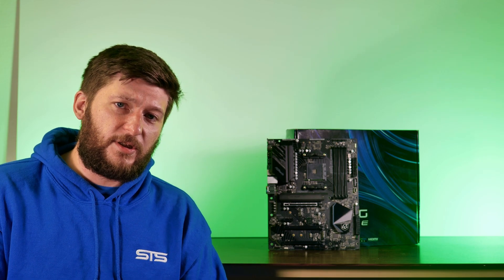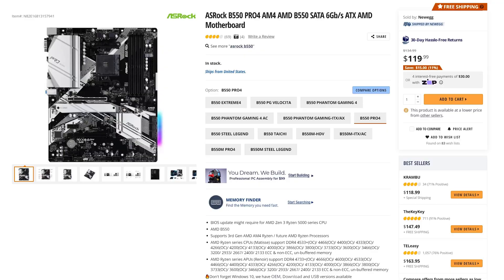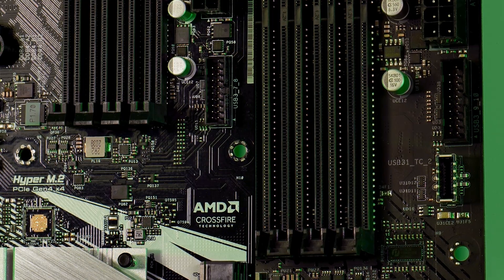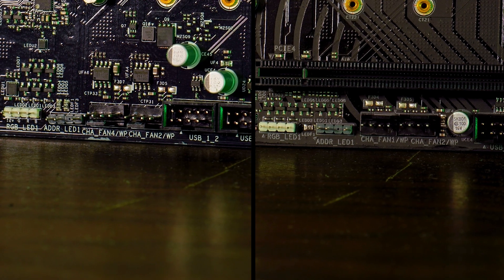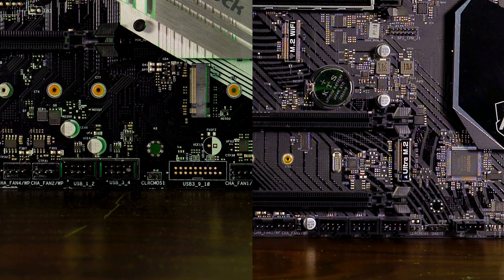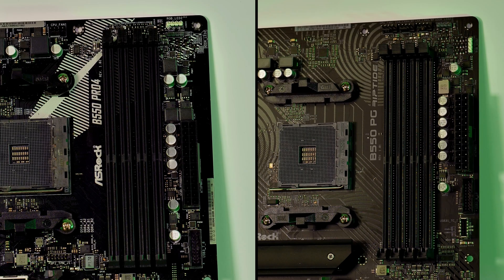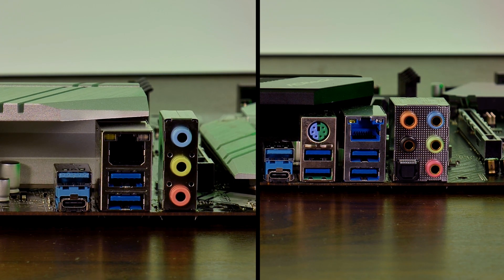As mentioned at the start, I wanted to compare this to ASRock's own B550 Pro 4 since they're priced similarly — the Riptide being only $20 more. For those $20 you get quite a lot: two more USB 3.2 Gen1 ports, two more USB 2.0 ports, a usable audio setup, one additional fan header, a front Thunderbolt header, an additional front USB 2.0 header, an additional USB 3.2 Gen1 header, a USB 3.2 Gen2 Type-C header, a secondary M.2 slot at Gen 3x4, an additional PCIe x16 slot, higher RAM speed support, a 10-phase VRM (two more phases), and most importantly a 2.5 Gbps network adapter.